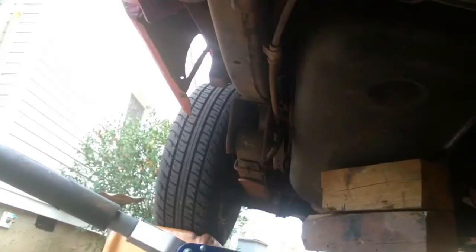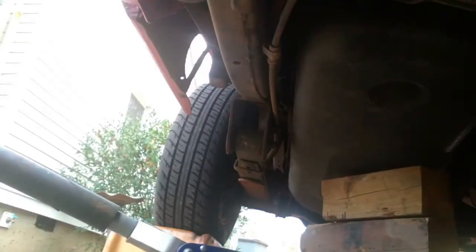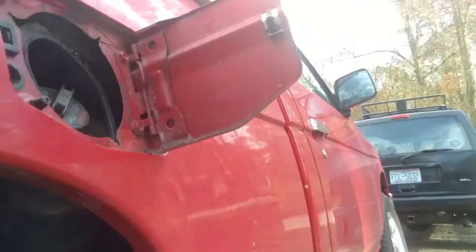I think I'm ready to drop the tank, but I'm not going to drop it all the way down to the ground. I'm going to rest it on a milk crate or something — or maybe a jack. We'll get a jack and lower it down real slow. Filler neck. You can see this plastic shield has got to come off. Looks like there's two 8mm nuts right there.